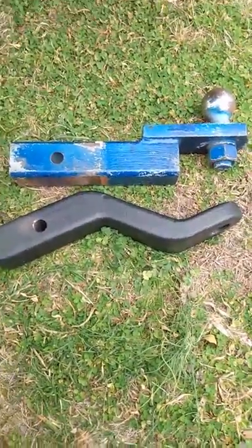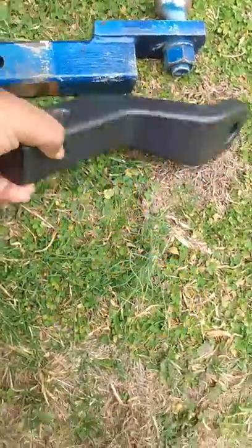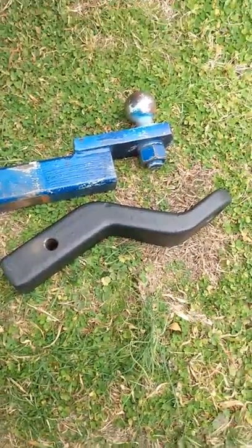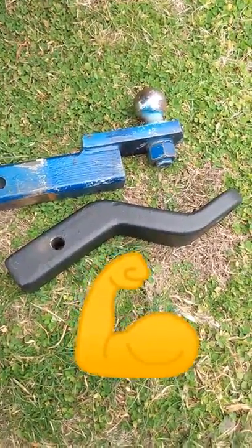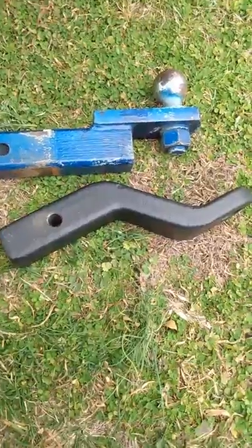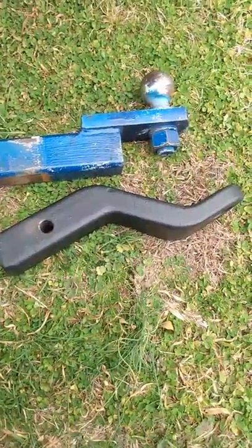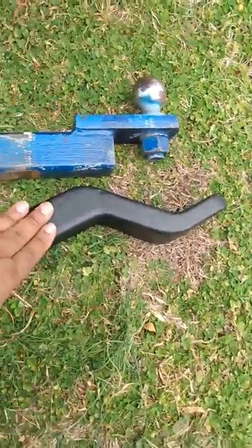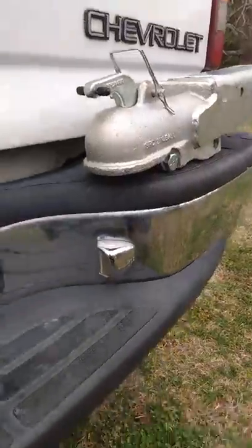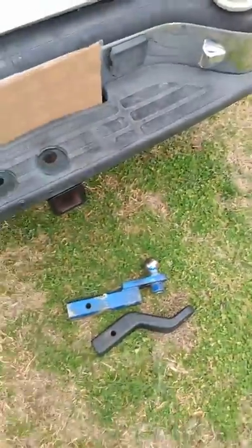I'll drop the link below. I just went on and got the Class 5 trailer hitch mount — Class 5. It's like above and beyond. And it's better to have something bigger — size does matter in this case. I put this bad boy on, I ain't got to worry about it breaking with what I'm towing. So I've got a 17,000 pound mount, a 10,000 pound rated ball, and a 10,000 pound coupler pulling a 7,000 pound boat.